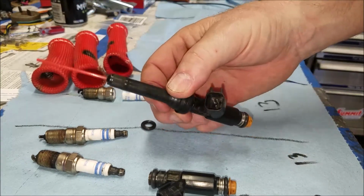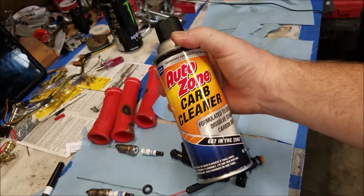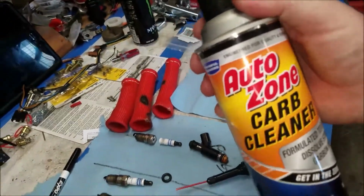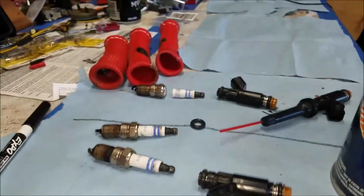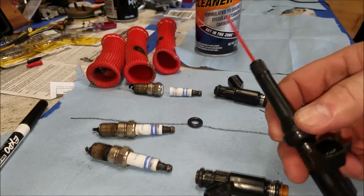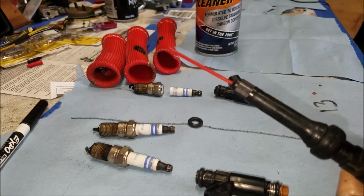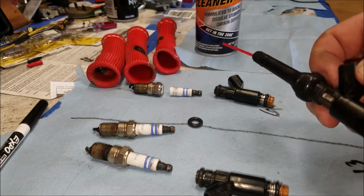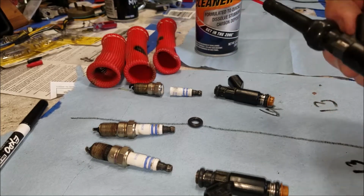And there you go. What I'm using today is AutoZone Carb Cleaner. Yeah, I need a sponsor, AutoZone. You're the man, or you're the company. Anyways, so I'm gonna use that, hook it up to the end, and spray through it. But you gotta hook power up to this. So I'm gonna put the alligator clips on there, hook it up to my little hobby battery, and we'll see if we can get it to spray a good pattern. Because this might be clogged, or I don't know. We'll see.